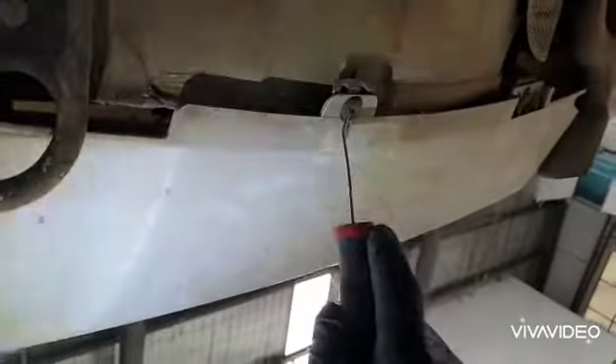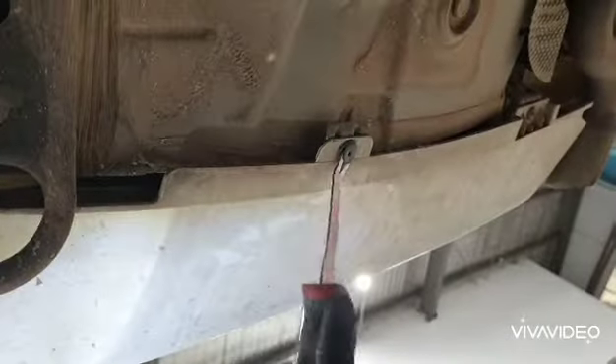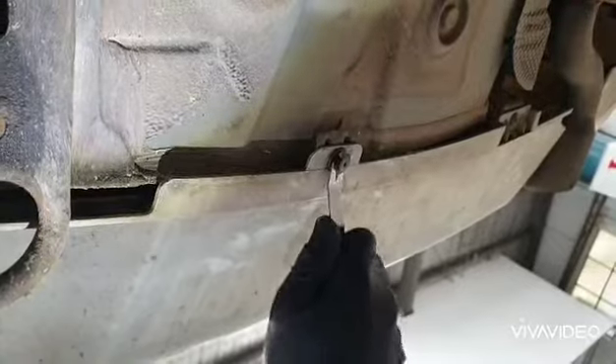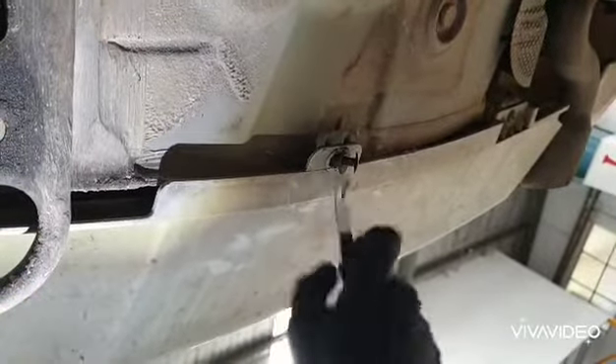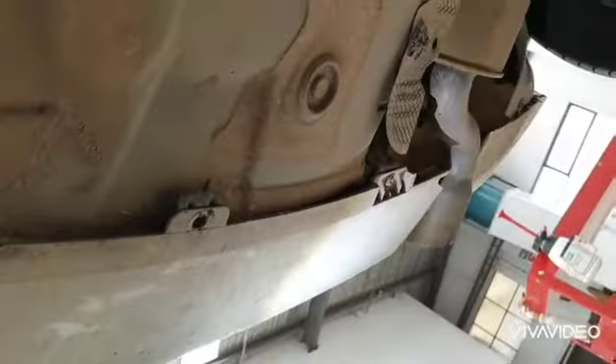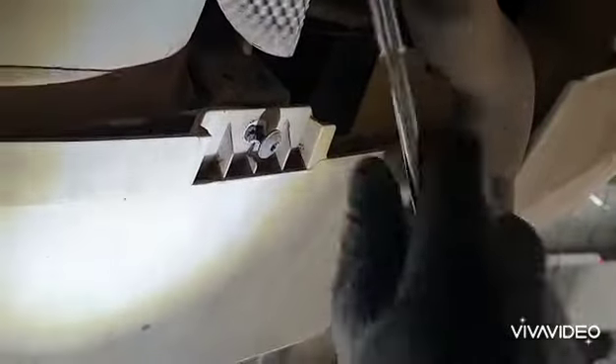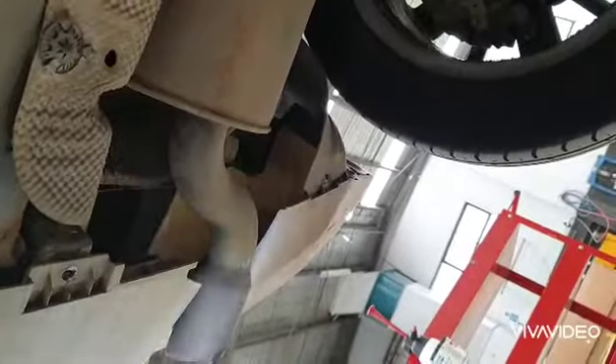With a trim tool, you want to get the centre of this clip, which looks like a rivet but it isn't - it's a plastic clip. Slide in the middle of it, get right deep into it and just ease it downwards. Once it comes out enough, get behind the main section and that'll pop out. Store that in your bag as well and move along to get the others. Easy to do at home for any of you viewers watching at home. Make sure you store all your screws in your bag ready for refit.